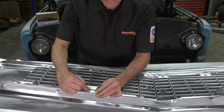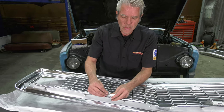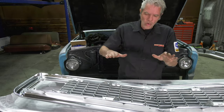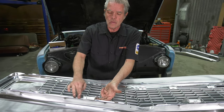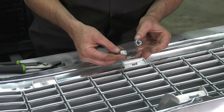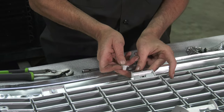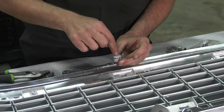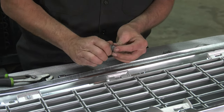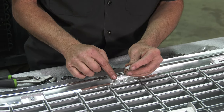Then you put on the screw, which will flare out the end and it'll be held in there permanently. The square holes are very, very specific — they're real tight, and the plastic can sometimes be slightly oversized, making it tough to get into the holes. You're going to have to be patient and work with it. I don't want to press hard or I'll push the edge of the aluminum in. So here's how I like to do these: I need support underneath the aluminum, otherwise it's going to bend. I'll simply take a nut, put it behind the aluminum, put the plastic piece through, and then take the pliers and crush it in. Then I can take the bolt off and put my screw in, which will flare out the prongs and hold it in there.